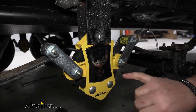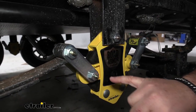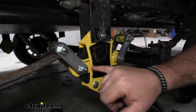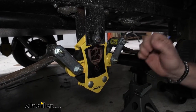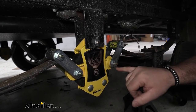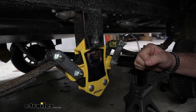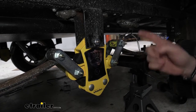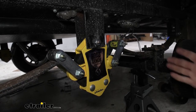Another great thing about this kit — if you notice the zerk fitting on the end of each of our bolts — that's a great feature because you're able to grease the inside of that bolt. There's actually a bushing inside each of these, inside your spring. Being able to grease that is going to make that bushing last a lot longer. The top of your spring probably has a plastic bushing; these are going to have copper ones inside. Rather than having metal-to-metal or metal-to-plastic rubbing together — which will eventually wear out — being able to grease them keeps them moistened up and makes them last a lot longer.